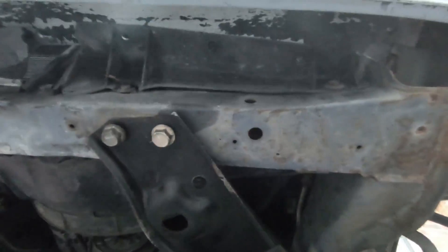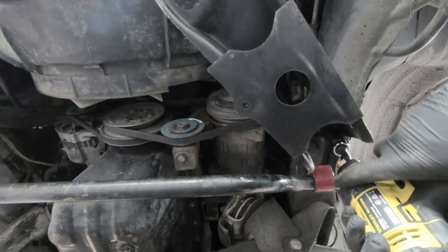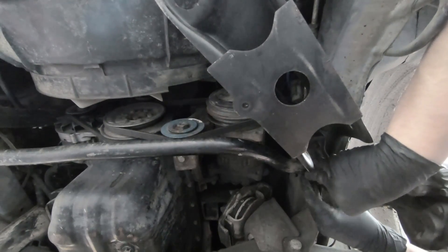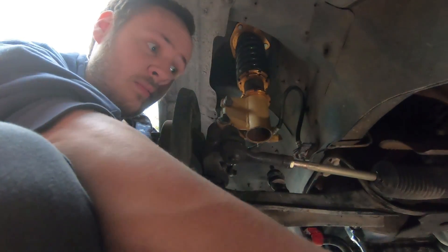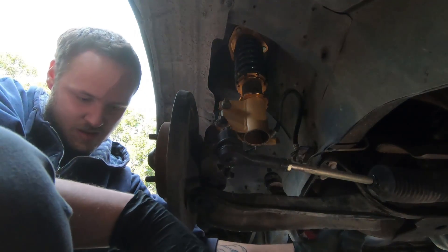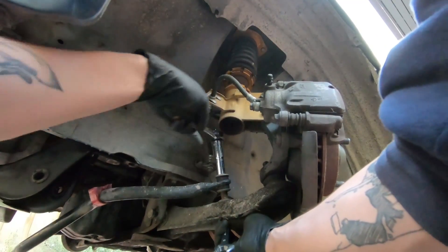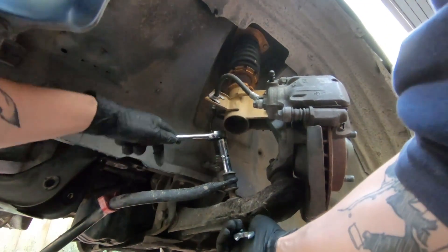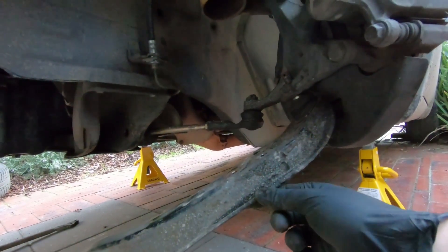Here's the great part about the S15 ones — they bolt up perfectly there, and on this back one here as well. Straight D-links, whatever they're called. This isn't as much of a bitch to get to — I finally managed to break it loose. These sway bar bushes are absolutely roasted. I really shouldn't put them back in, but I've got the lower control arm out over here.